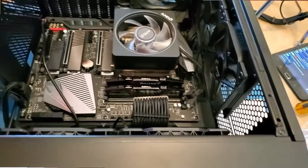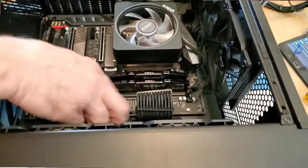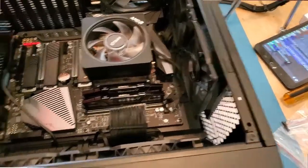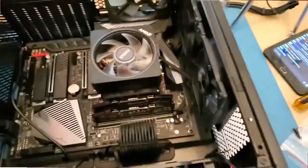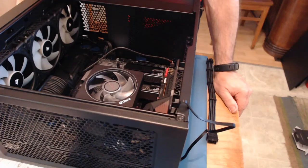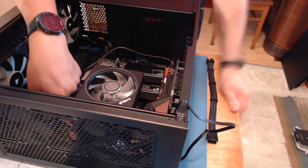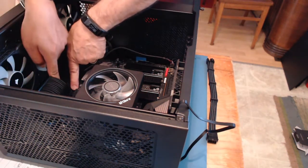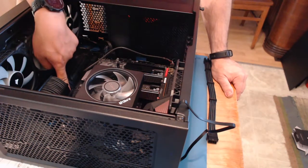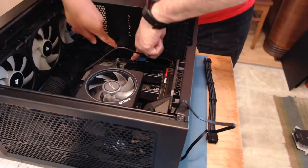So next thing is to plug in a graphics card to see if it will post. Well, we should plug the fans in. Oh, that can wait. I want to plug the fans in. Sure, it's your call. Where's the fan go? Okay. Fan 1, 2, 3 right there. LED, CPU. Right here, I think. Yes. System fan 1, fan 4, system fan 2, system fan 5, and you will have other connectors a little bit around the board. There's a system fan pump here.